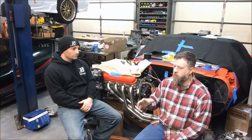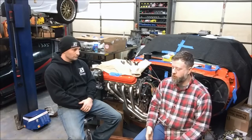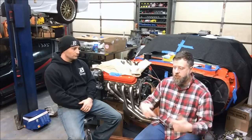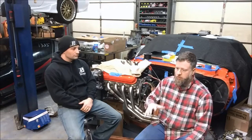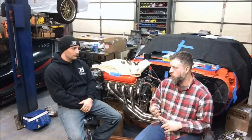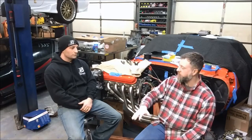From John's perspective, that really creates more of a headache. Those Gen 3.5 LS2s — with the cam sensor mounted in the front of the block, knock sensors low-mounted instead of in the valley, and a four-bolt drive-by-wire throttle body — have a unique wiring harness and a unique PCM called the E40. The other Gen 3 motors had what we call a red-and-blue PCM for drive-by-cable or a green-and-blue PCM for drive-by-wire.